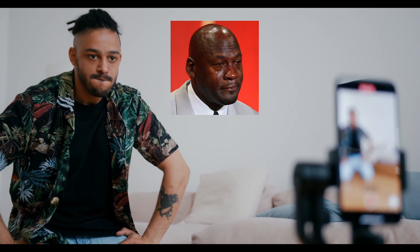I'd also like to highlight the different wattage you'll experience across these devices. The Home Assistant Green and Raspberry Pi use ARM chips, so they draw significantly less power than the x86 CPUs you'll get with a NAS, old laptop, or mini PC. It's a trade-off: do you want to save on electricity, do you plan to add lots of devices soon, or do you just want a small form factor device you can chuck in a closet and forget about? Ultimately, it's up to you to decide what suits your needs. Don't forget to like, share, and subscribe if you found this useful, and drop your thoughts in the comments. This has been Automation Haven — see you in the next one.